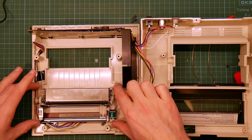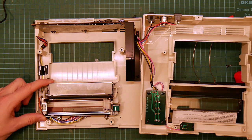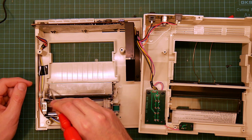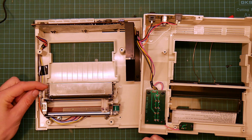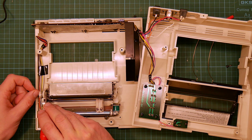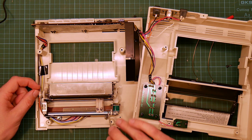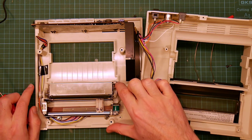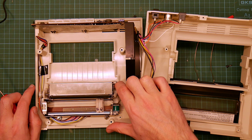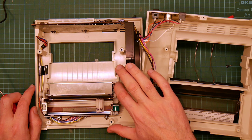Here is the actual plotter mechanism — this minuscule little thing. There is a stepper motor in here behind the shield, and another one in here. They drive these little wheels. This is the one that drives the printhead — you can see it moving. That is the cog that tends to fail. This is the one that drives the print roller, so I can turn this by hand and that feels nice and smooth.